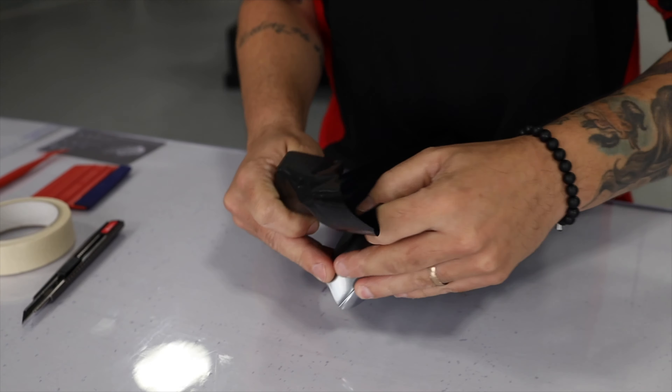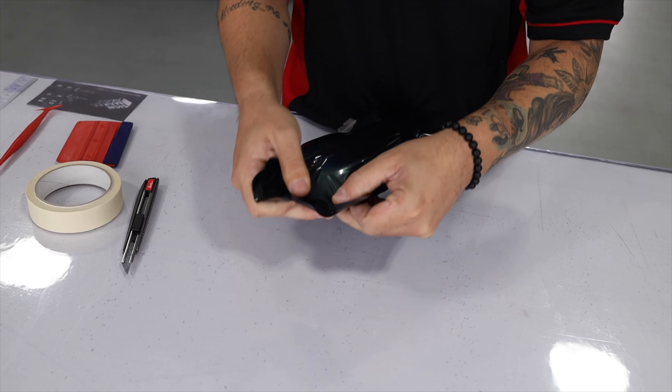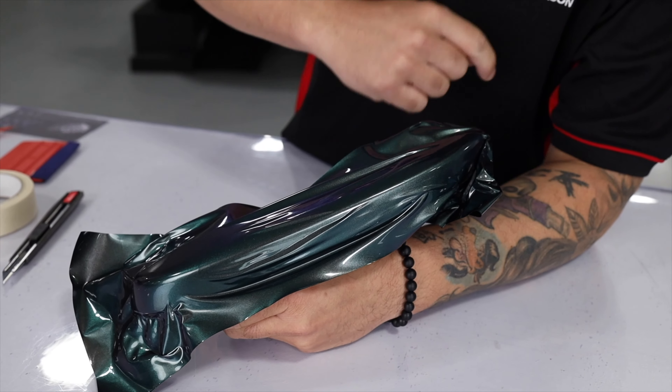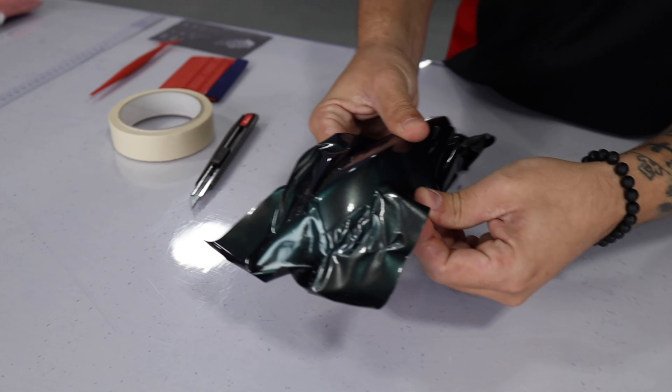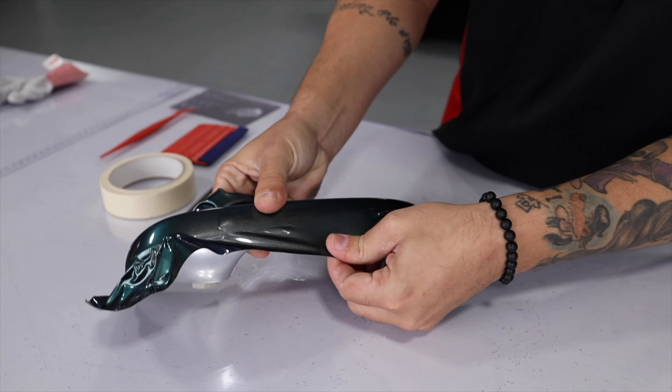Because the door handle is off the body, use the fingers that aren't holding the film to hold the door handle in place, then stretch the material evenly towards the corner. By stretching the material before putting it on the handle, then stretching from corner to corner, the middle section simply snaps into place.